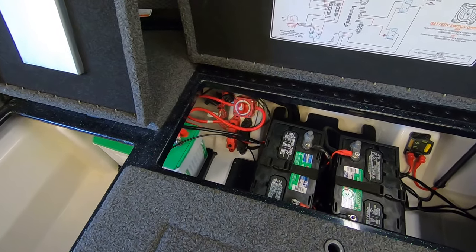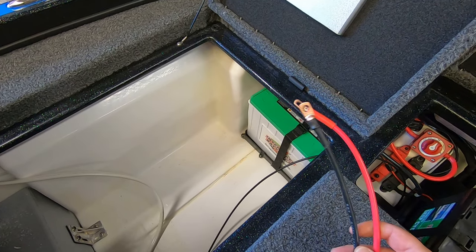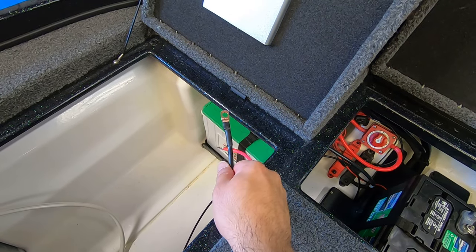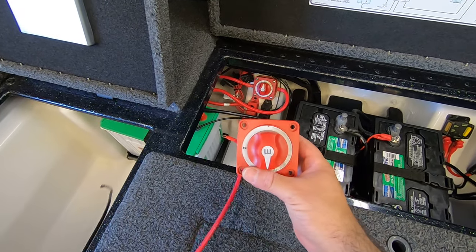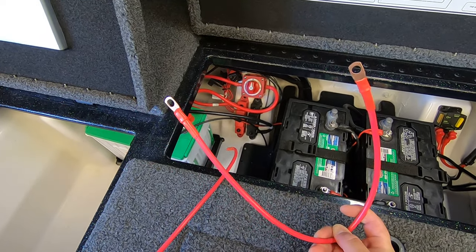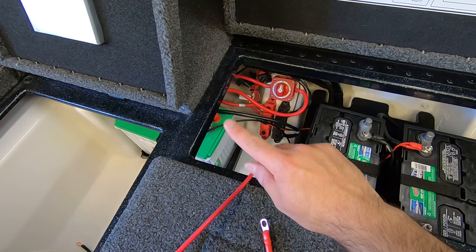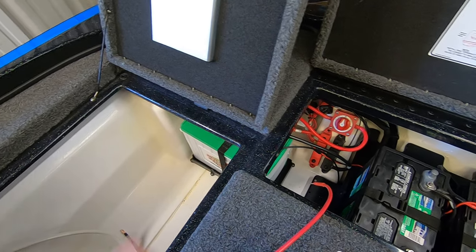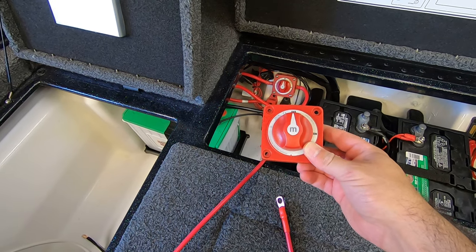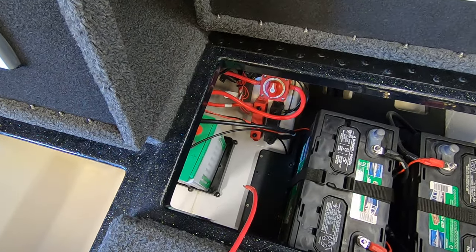Back at the battery compartment. I've got the extension power wire coming from the black box with two ring terminals on it. The negative black side goes straight to the battery. The positive side goes to my new switch, and then a little positive jumper wire goes from the switch to the battery. So going in reverse from the power supply: battery positive to the switch input, switch output to the black box positive, and battery negative straight to the black box. The switch interrupts that circuit — when you turn it off, you're cutting the power.